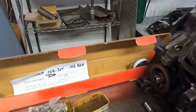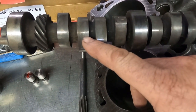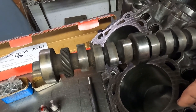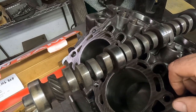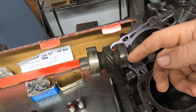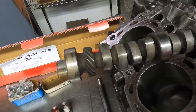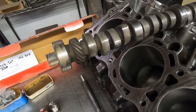This really isn't about getting nerdy with cam grinding. Looking at this Ford cam — Fords do taper both ways. What I really want to show you guys is how to check your own cam if you don't have any extravagant tools. The cams have taper — an older Ford with a smaller radius lifter might have one and a half to two thousandths taper across it. Some newer engines where lifters have a bigger radius might be eight-tenths to 1.2 thousandths. That's all kind of nerdy statistics if you have the tools, but if you don't and you're just working in your garage trying to figure out if you're going to have some success, that's sort of what we're getting at.